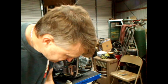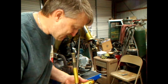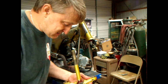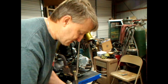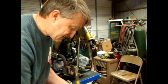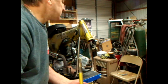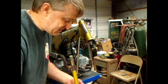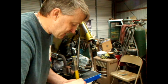But anyway, I'm going to go around here by hand, stick them in that grease. You want to make sure they're all the way around. Probably best thing is not to have this too high off your work table, so if one falls out, you can catch it. I'm just going to put these on there and set it back down. I do got to apply some grease to the top and put the balls in the top. But this, you can do it this way, that way gravity doesn't work against you.